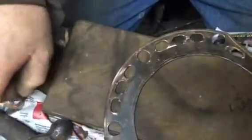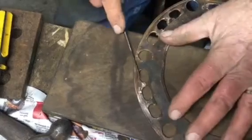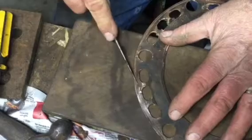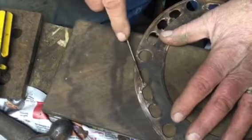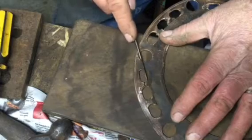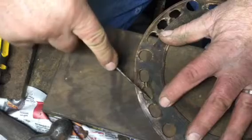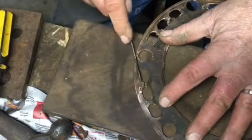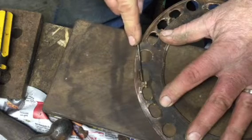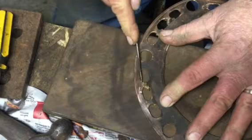Well, good morning. I'm back at it. A little more work on the gaskets here. Now, some of these places, see the water jacket goes just around here, and this doesn't get squeezed, and that's why these are bulged. And where they're bulged, I'm going to take that gasket material out of there because it's probably just going to come loose and get into the water jacket anyway.